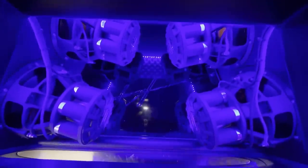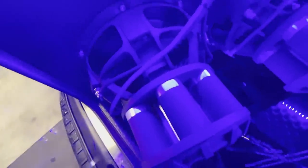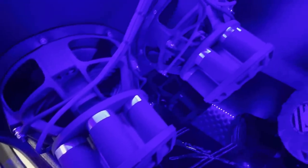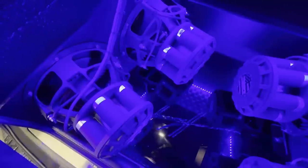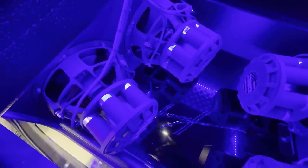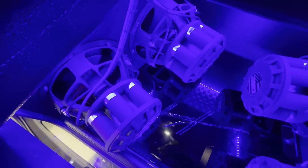And as you said yourself earlier in the build, there was a big null in the 50s. And funnily enough, it turned out, yeah, absolutely. It was a huge hole, about 53 hertz. So this being a fourth, it's got a hefty peak on it, especially with the volumes involved. So I decided that I'd hide the peak in the null. So hopefully this will be pretty flat. Yeah, we don't have to fight that. Well, we will see.